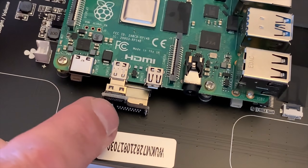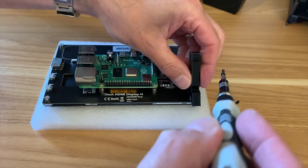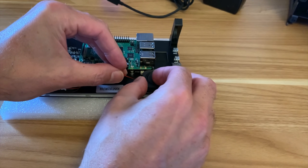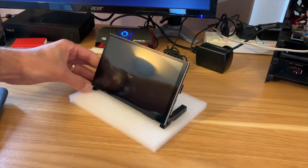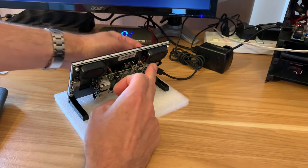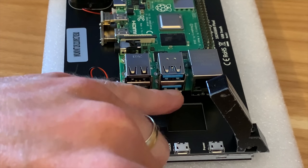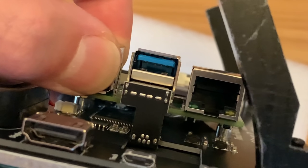So that's the micro HDMI to full-size HDMI - that's what's sending the picture to the monitor. The legs go on so it has a lean-back sort of design. Now we just need the speakers - they've just got to peel off a bit. The speakers are plugged in - it's much easier to plug them in before you stick them in place. You can see the display with the HDMI and power socket. Under here there is a micro USB attached to the screen, so this must be the touch functionality. That's gone in - so you can see the touchscreen connector there. It's kind of like a mini laptop with this Bluetooth keyboard.